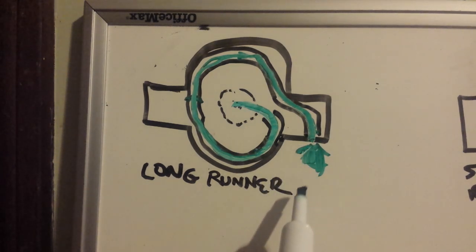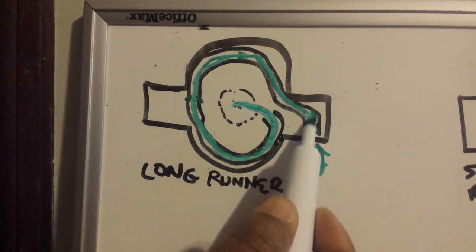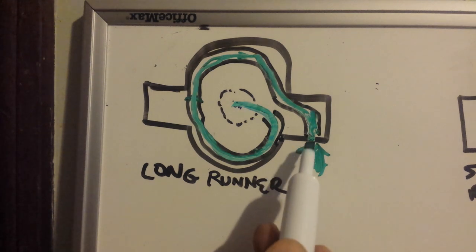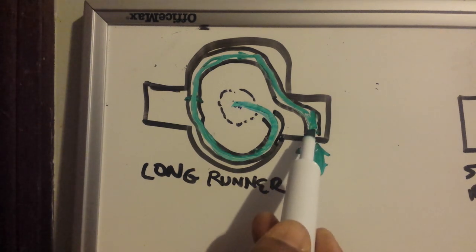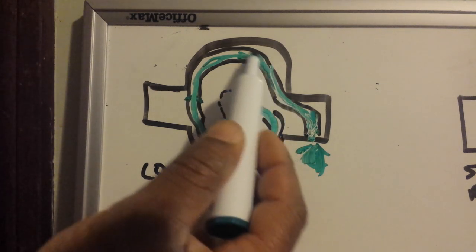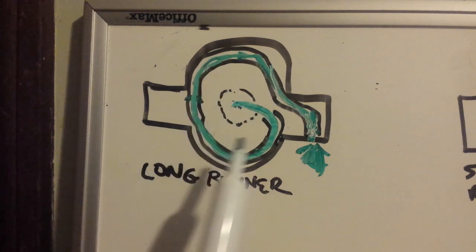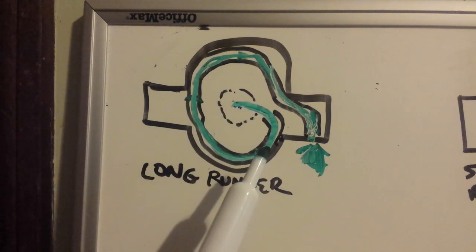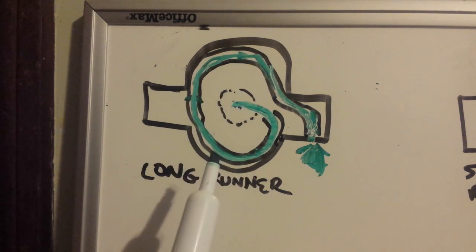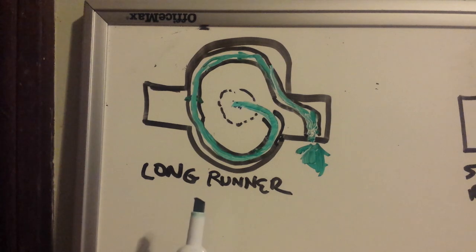And what you then find is, as these air intake flaps are partially closed, a lot of that air is then forced or held back inside this chamber because the car is idling. There's not much demand for air or fuel. And because of that, you get reduced gas consumption, better fuel economy.